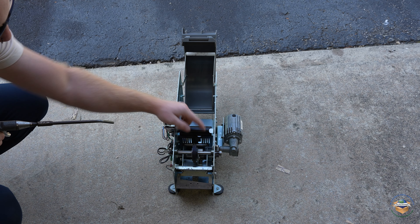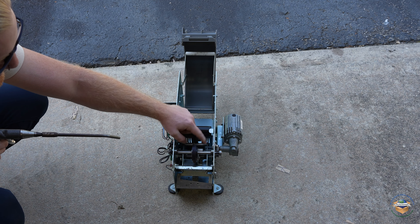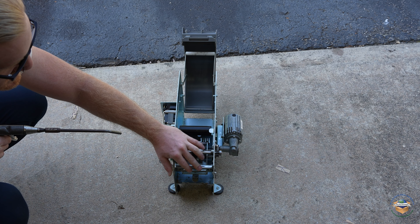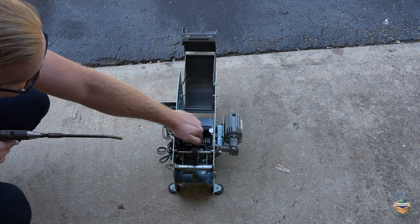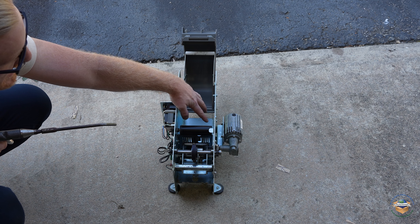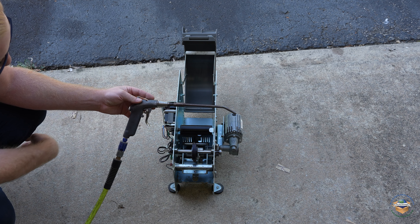Now this machine is ready to blow out. When you're blowing this machine out, it's really good to focus on this area right here — the core of the machine. This one's pretty clean, probably went out of service when that spring broke, but oftentimes when you get this far in you'll see a whole bunch of tape down in here. I'll also blow out the basket area and blow off the motor as well. We use an air compressor with an air gun right here.